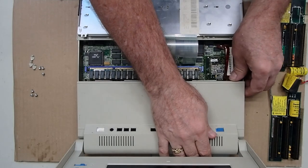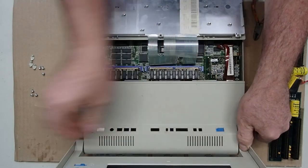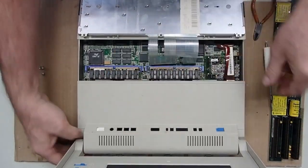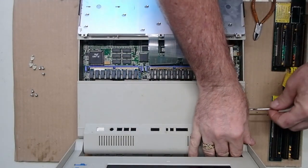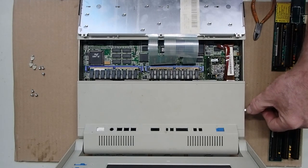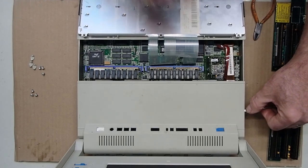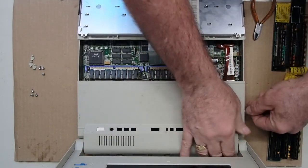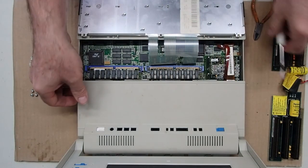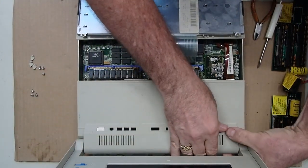Now, on the back here, since we have these screws loosened on those back pieces, we actually pull up on the back. And as I say, those doors, and of course they're off screen for you guys, they go through and drop when we pull that up a little bit. Now, on this edge, and this is the left-hand side of the unit as you use it, midway in here, there's actually a slot recess. And this is kind of a critical piece to get up this back panel here. And you just hear that click as I've gone through, and be gentle again for that assembly.